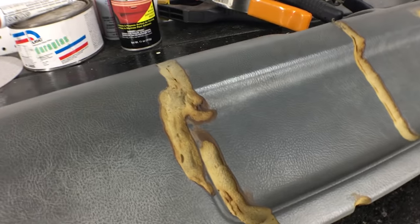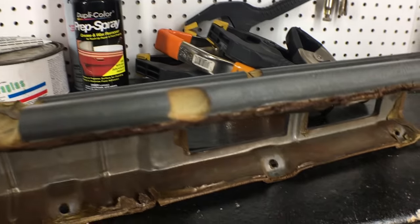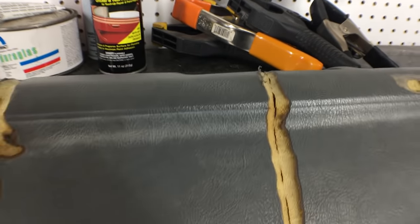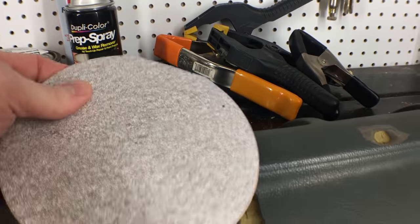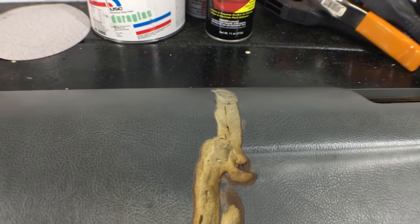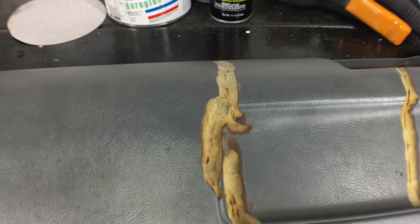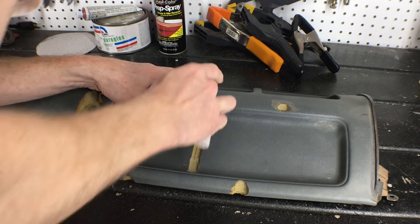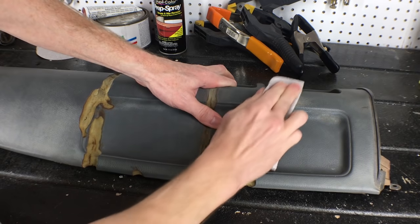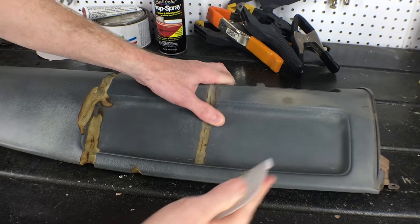You're going to need to chop back as well. Now I'm taking a close look at all the grooves I just cut, to make sure there's no crowning where they poke up in the middle. Next I need to sand these with some 80 grit sandpaper — that's to help give the filler something to bite to for a better bond, because it's not going to bond well to a smooth, non-porous surface. I'm sanding along the edges of the groove, and also around the outside of the groove as well, giving myself plenty of extra scuffed surface to spread the filler.